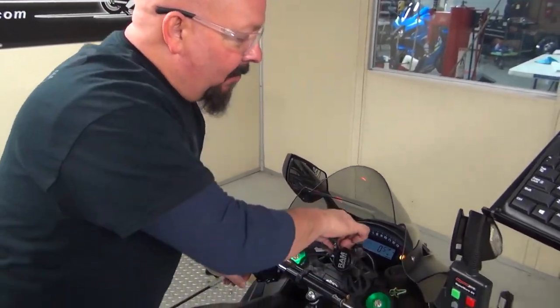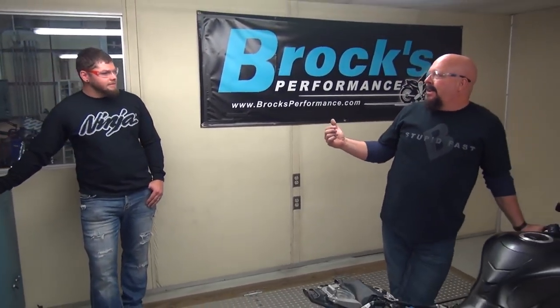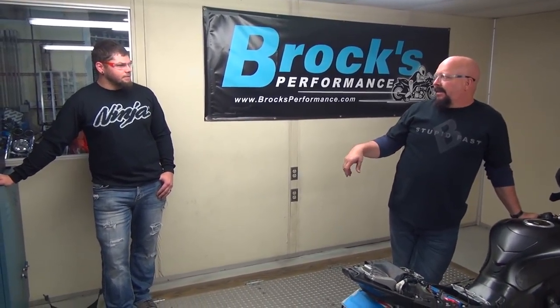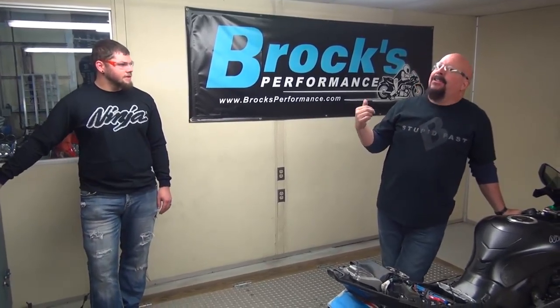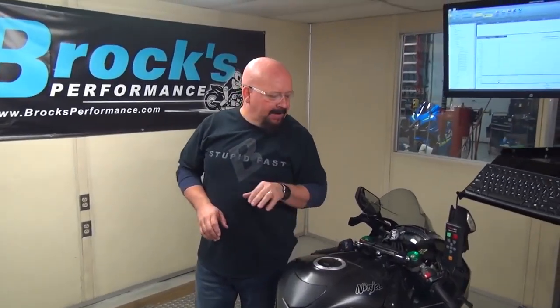I couldn't even see the mileage before. Now, if you don't have the user reset, you have to follow what I call the secret handshake. Have you ever done it? Yeah, it's a pain in the ass. It's so brutal. You've got to go for 3 rides over a certain speed, 25 miles an hour the whole time, for, I think, 15 minutes each ride. Right, and then cycle the key, turn it on, do it again. Last time I did it, before we had the user reset on the Z900RS, it took me 45 minutes before it would finally clear up on the dash. We just did this in seconds. Talk about an absolute lifesaver.